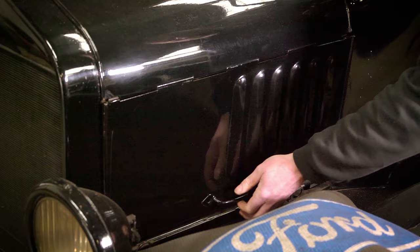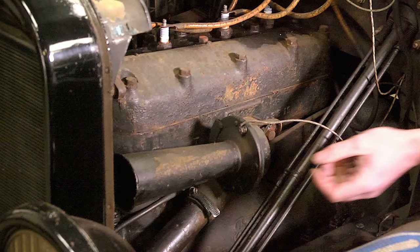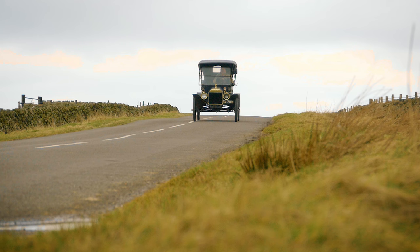The place to look for cracking on the block and on the water jacket — take a look particularly down the left-hand side of the engine, as that's where it tends to show the cracks. The gasket surfaces aren't up to modern standards, so don't be surprised if you see a few drips of oil underneath the car, particularly after a run once the engine oil is up to temperature and running a bit thinner. If there are particularly large pools of oil, you need to investigate further. The engines will keep running until they're in really poor condition — you can go to a Model T rally and hear some cars that you think just shouldn't be running. It's not how we recommend you drive them, but they will keep going until the last legs.